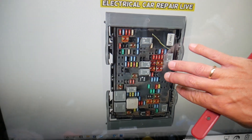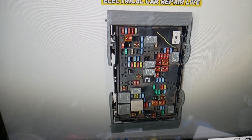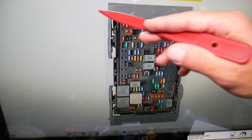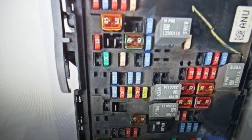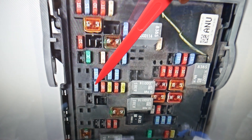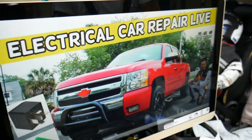The EVAP system fuses are actually hidden under a different name, so if you looked for them, you probably didn't find them — and that's why we're making this video, to save you time and money. Orientation-wise, that side of the fuse box is facing the front of your Chevy Silverado, this is the windshield side, passenger side, driver side. We're looking for fuses known as engine control module fuses. The two fuses we're going to check — one of the functions is for the EVAP system — and we're talking about fuse number four right here, and then fuse number five right there. If you have any questions, don't hesitate to let us know. Hopefully the video was helpful and see you guys next time.